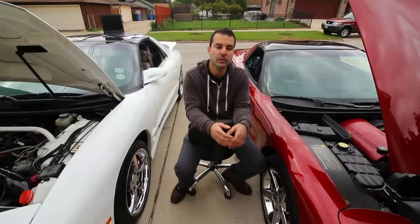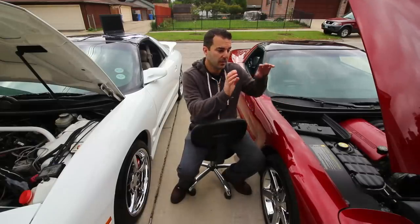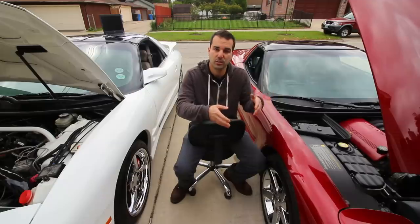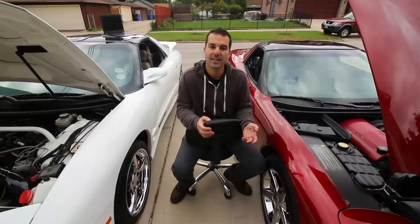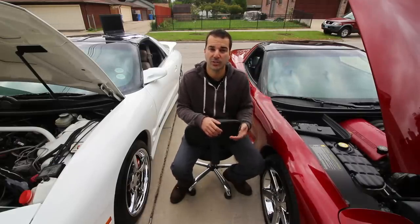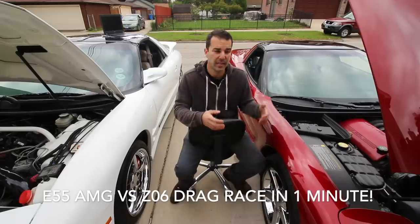So what we're going to do is kind of our own way of making this car run leaner, which is what I've explained, which is getting rid of the mass airflow sensors, disregarding what the narrowband O2s are telling the computer to do, and we're gonna fine tune this to run maybe 16, 16 and a half air fuel. We're not entirely sure on the number just yet, and this is why I have teamed up with Mike Hornback of Hack Tuning and with Straight Line Performance, because we're gonna be on the dyno taking a lot of measurements, air fuel measurements, a lot of logging.